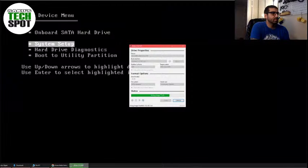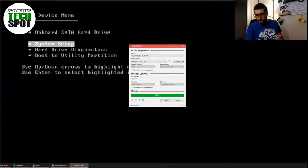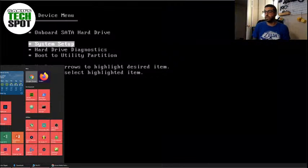Oh, I think that's the problem right there. Target system UEFI. No. This computer definitely does not support UEFI. And I think that's what I should have changed. Well, I'm going to give it a chance to finish. It says BIOS or UEFI. But did it say that while I was doing this? Let's make sure. I don't even see it here. Whatever. Let's try this one more time.